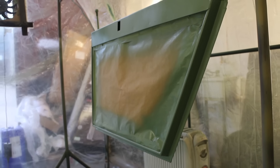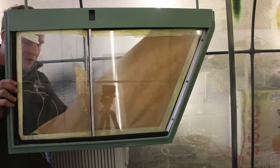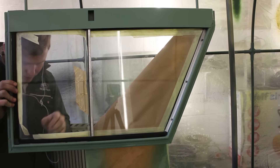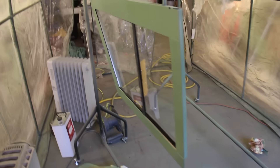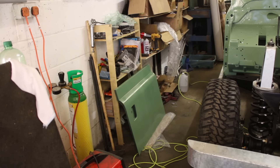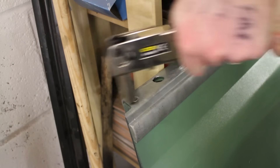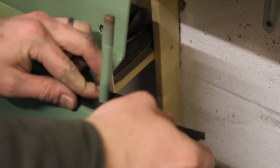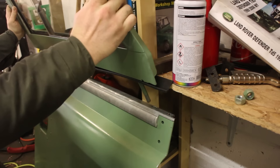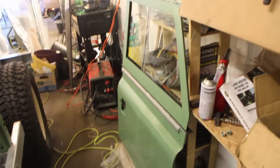We have finished painting the doors — it took quite a length of time to mask them off properly, but it was totally worth it. If you spend more time masking and preparing, you get a much better paint finish: really good finish, nice clean edges, no overspray. We're assembling the split doors for that retro look, fitting cappings with foam underneath to match the rear tub height, then rubber seals on the top half before bolting the two halves together. We've also switched to sliding windows instead of wind-up ones.